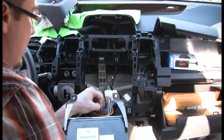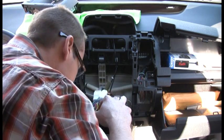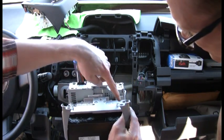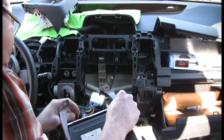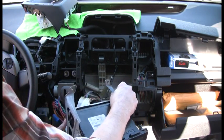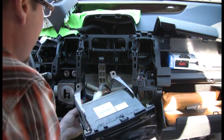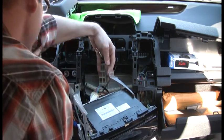Clean this wire up a little bit. This will go into your factory radio back here — you'll be missing the speaker connector but that shouldn't matter since all you really need is to power it up, and your other factory wire goes right back in. It's a little tight, so make sure you get them all in. Also make sure you have cloths down — without them the pieces will slip and you'll scratch the dash trim. Make sure you plug the antenna into your new radio; it sounds silly but stranger things have happened.